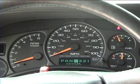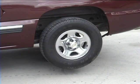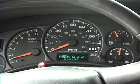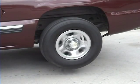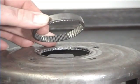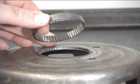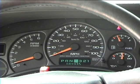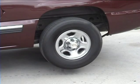Before moving into the drive position, completely stop the wheels from turning. Never move from reverse to forward or vice versa while the wheels are turning. This is one good way to strip or snap the spline collar on that sun shell. Moving the selector to drive, the wheels should move in a forward direction.